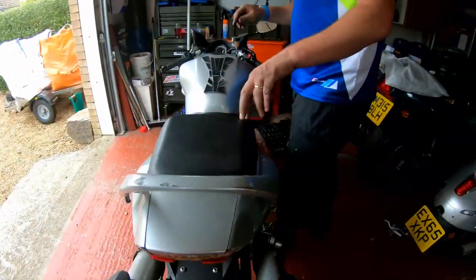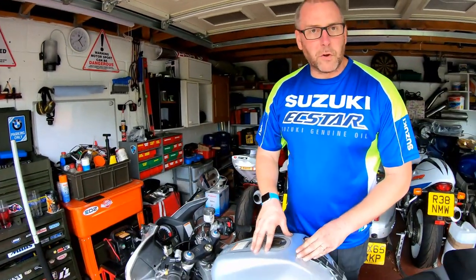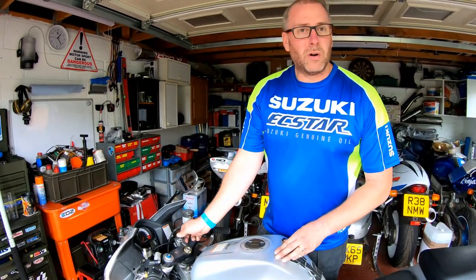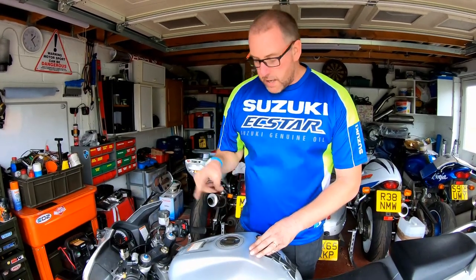Before we get on with that, I just want to address something from the previous video. There was a funny noise from the fuel pump when we turned the key on, and I said it was most likely air. Well, as you can tell, when I turn the key on now, no noise at all, and that's because I ran it. Obviously, what it did was it bled the air out, and that was all good. So yeah, let's crack on with the job for today.